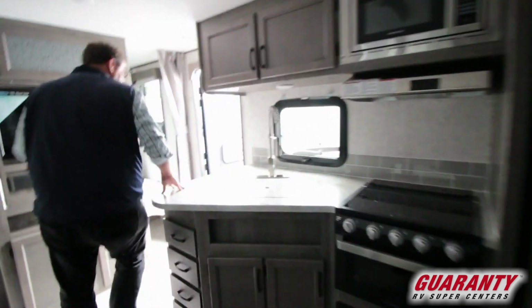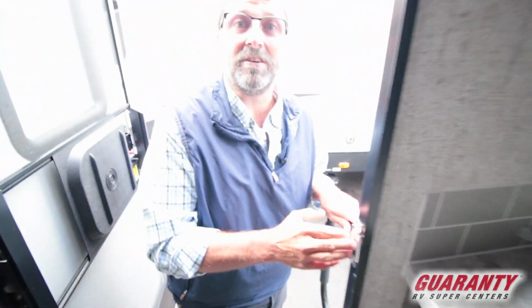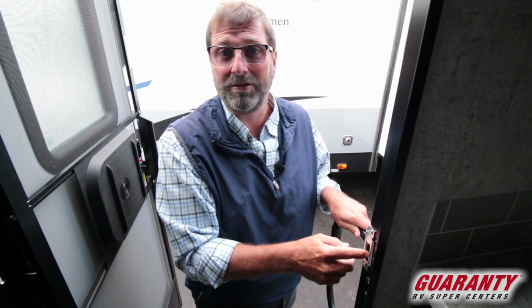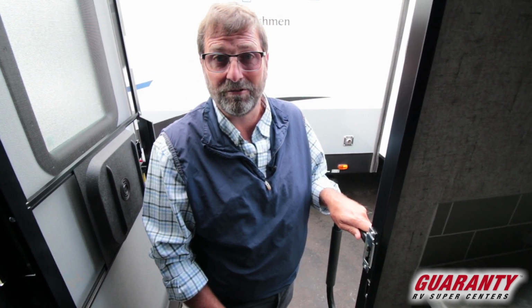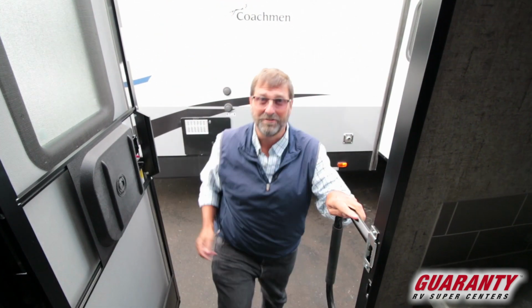The sidewalls are even better on this because it uses a special material here in an underlayment called Azdel. Most trailers have a layer of wood under their fiberglass, so even aluminum frame trailers still have problems with delamination and dry rot. But this trailer doesn't have that issue because of the Azdel underlayment.